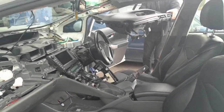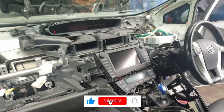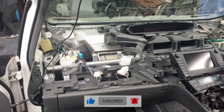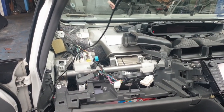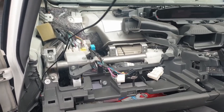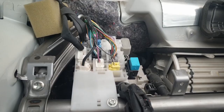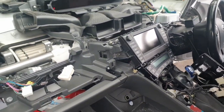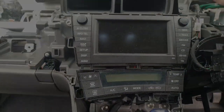From this position you can do a lot of things — you can take out the speedometer cluster, work with the power steering modules, or access the fuse box which is on the passenger side. You can also work with the air vents on pretty much all of the dashboard. Another advantage of taking out the dashboard with this technique is that you can change the passenger airbag, especially if you've bought a car or are working on one that's had accidental damage and the airbag has come out. This tutorial will be really helpful for you.